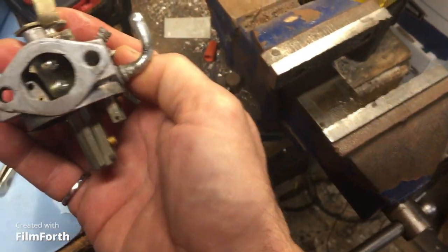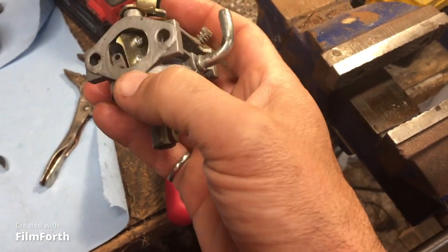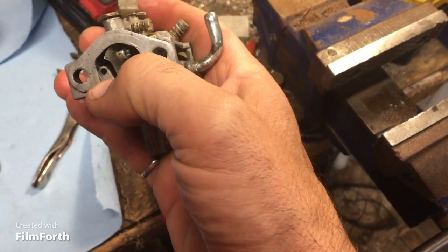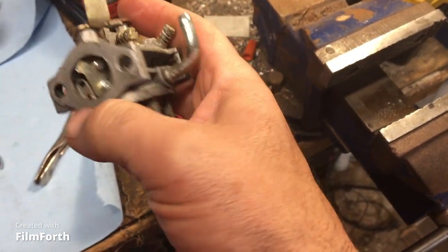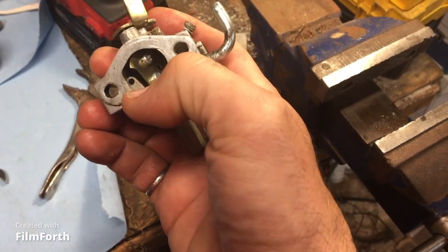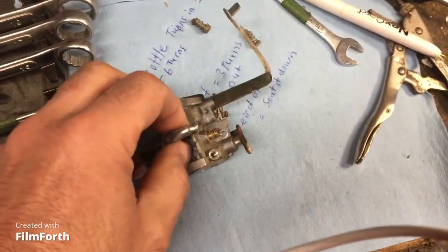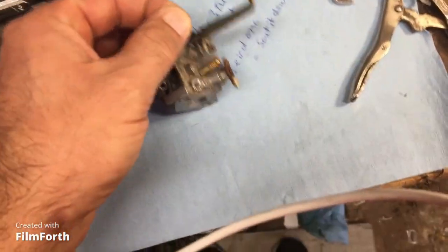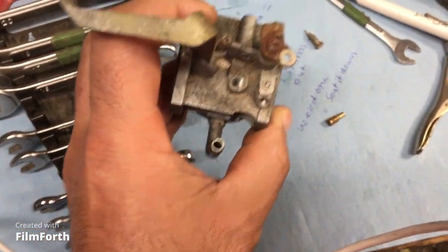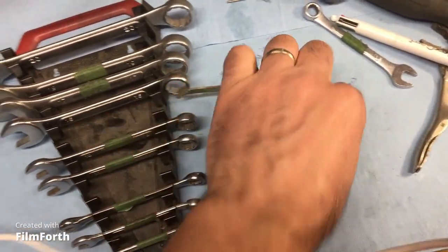We'll squirt air pressure and WD-40 down these. These are pickups, right? This is the air inlet side, so this is most likely from your pilot jet. There's two kind of pilot jet air in, right? And okay, so this is that weird screw, right? So we're gonna take that out and see. Oh, so it is air in. Wow. So it's grabbing air from right on top of the carburetor. I've never seen that before in my life.